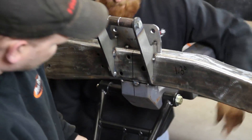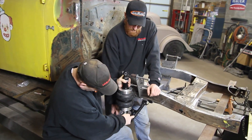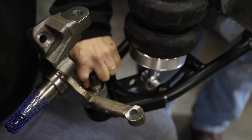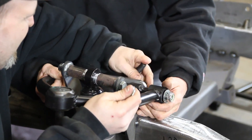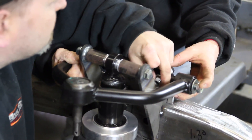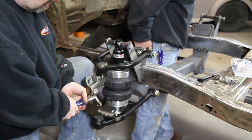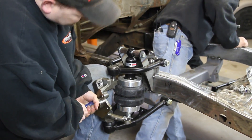For final assembly, we'll put anti-seize on that bolt so we can get it out. The lower control arms at ride height will be, for all intents and purposes, parallel to the ground. That's going to give us the proper geometry for how the car's going to sit just right. One of the things you might note is that the shockwave is in upside down — shockwave doesn't know it. The reason we do that is particularly on the top here; it gives us the clearance that's necessary, and it can run upside down all day long and it don't care.